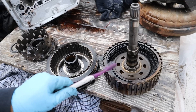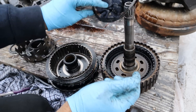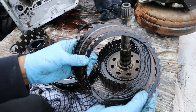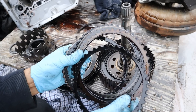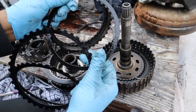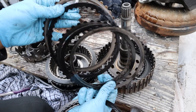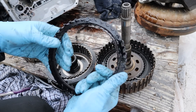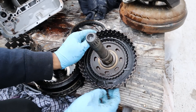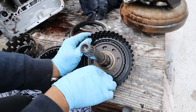These three clutch packs are nestled together and I just took them apart. You can see the first part of that clutch pack from the back of the transmission — let's pop out these clutches to see the condition. It's already pretty black. It's completely black and burnt out — this stuff is completely done for. These are the friction clutches — they're supposed to have a little pattern on them to help them grip the steel when squished together, but it's completely smoothed out. This is why your transmission fluid would also seem burnt out — watch out when looking for a used vehicle to check the transmission fluid. Looking inside, there are fragments of friction material that was breaking down.